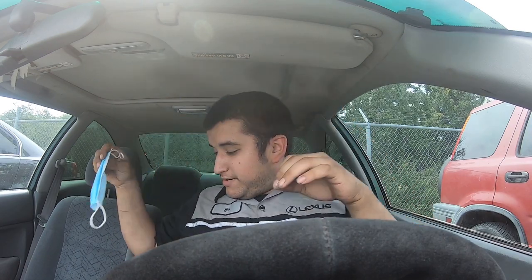Good and bad news. So I've got the head studs installed. I've got the OmniPower 4-bar map sensor installed. And I turned up the boost and got the tune kind of roughed in. It's not perfect. Started off a little lean. I think last time I checked, I was at 12.0-ish. I took out even more timing just to be safe.